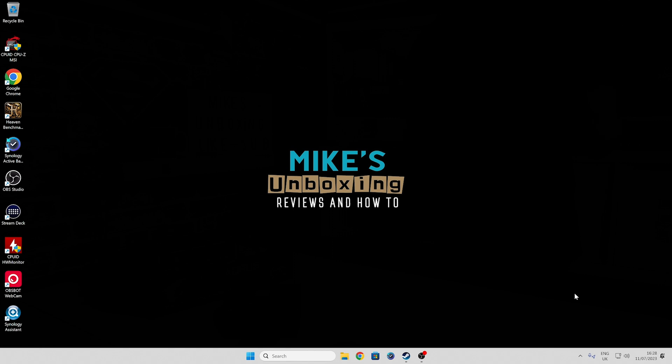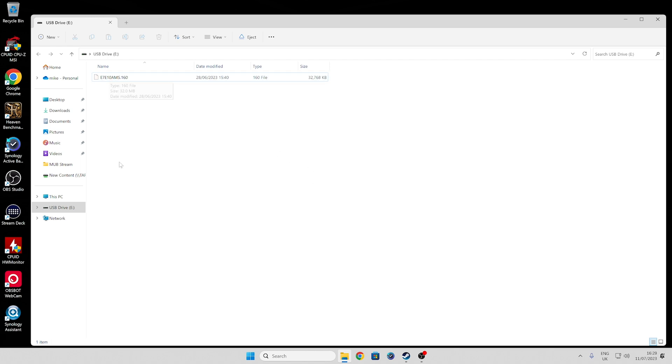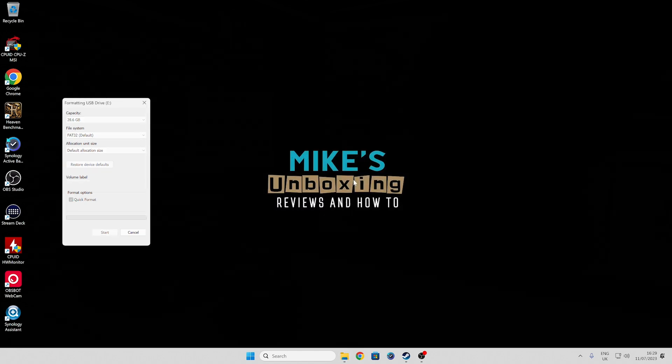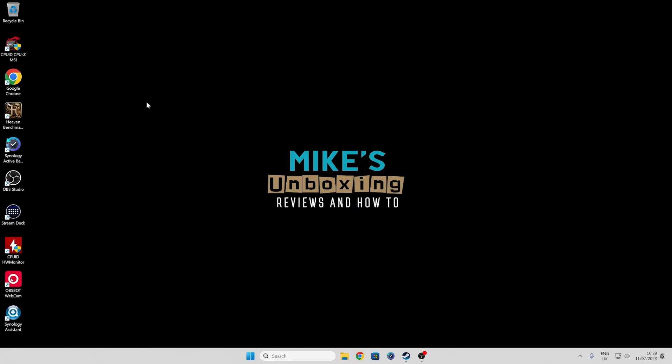We're on a Windows desktop on another computer. Insert your USB drive — this one actually has another BIOS on it, so I'm going to format this drive. It's always beneficial to do this. Right-click on the drive, choose Format, and make sure it is in FAT32 — it won't work unless it's FAT32. The allocation size you can reset to default. If there's anything written in the volume label section, I would strongly suggest removing that, as for some reason it doesn't like things written there. Click Start, confirm the warning that this will erase all data, and the format will complete. That is our drive prepared.